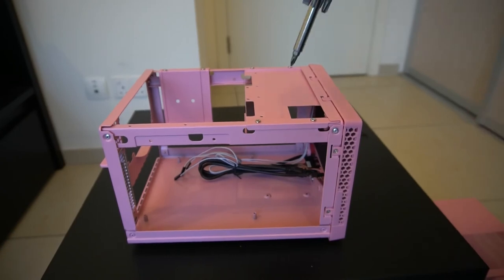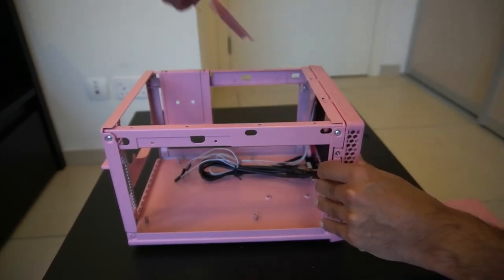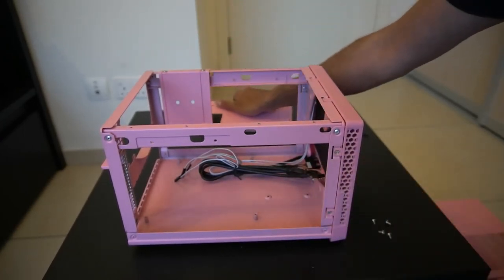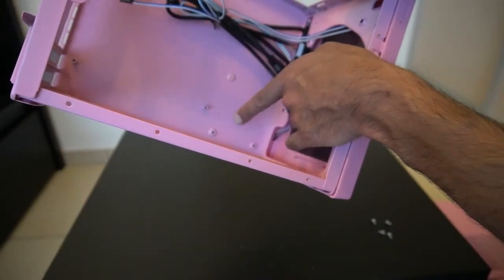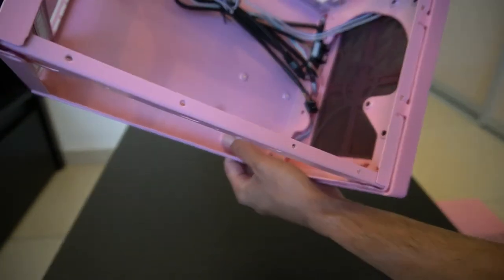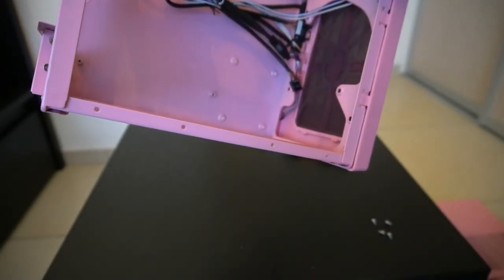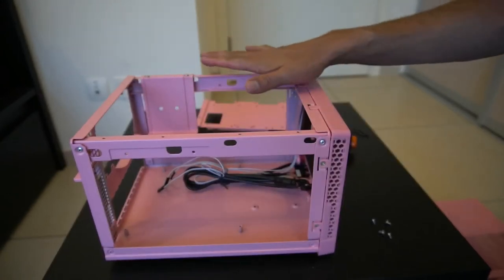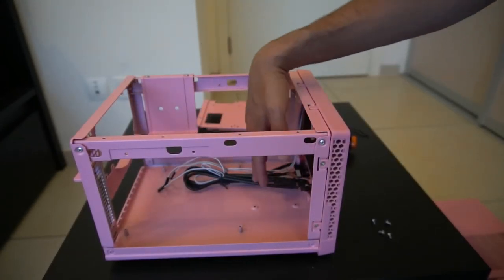Let me remove these four screws and take out the drive bay. Now you might wonder where your drives go without the bay — there's actually a secret compartment at the bottom of the case: four holes here are actually space for a 2.5-inch SATA drive. Removing the drive bay opens up your entire case interior if you want to add a bigger power supply or a thicker CPU fan.